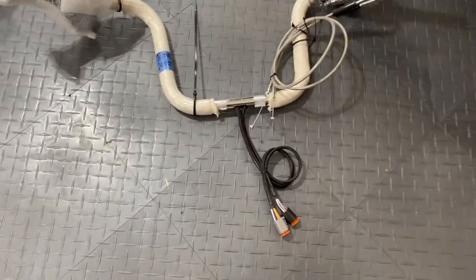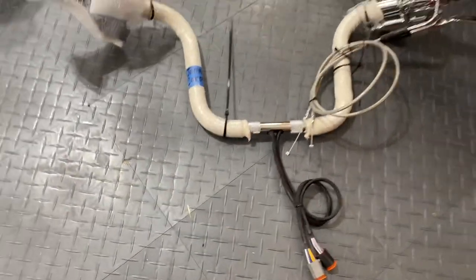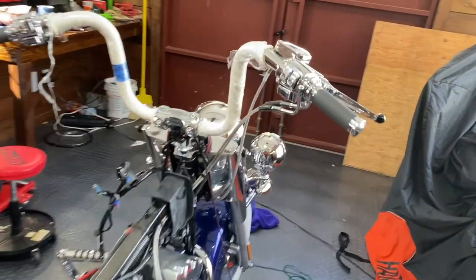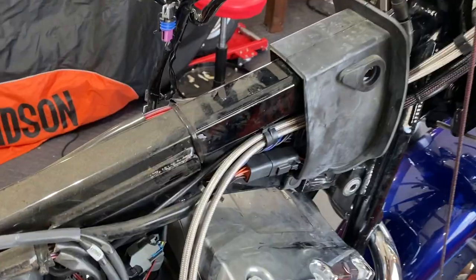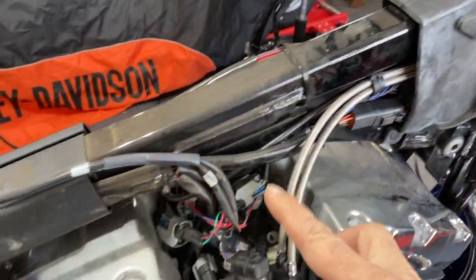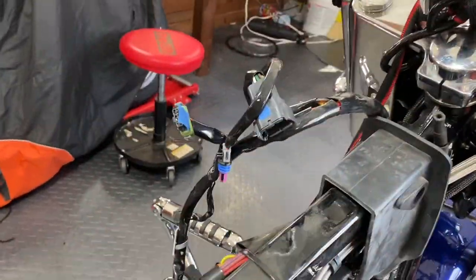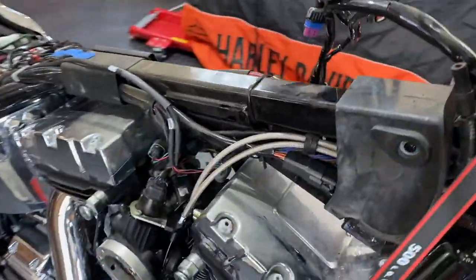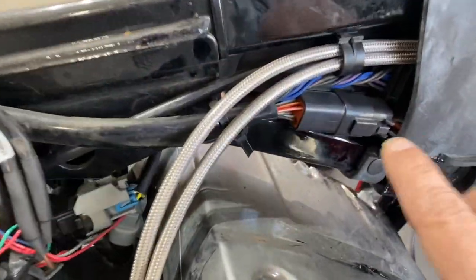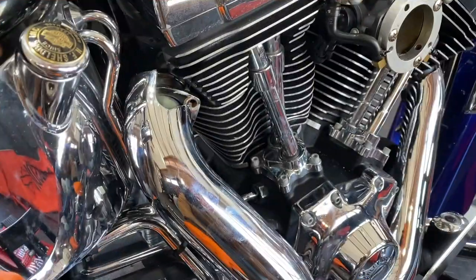On the other side, this connector is gray. What's nice is that Hill Country Cycles gives you the same color coding so you know which one to plug in — which is great. Here are the pre-wired handlebars with the Deutsch connectors, gray and black color coded, so no mistakes — makes it pretty simple. I've attached all the cabling, the throttle cabling coming in along the spine of the bike into the throttle housing, and also the electric wiring which comes along into the neck — all pre-wired inside the bike, connects right in at that Deutsch connector.